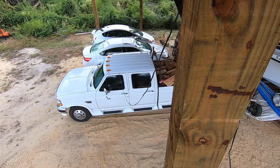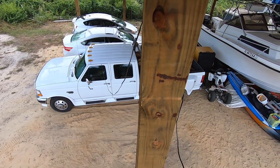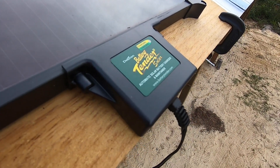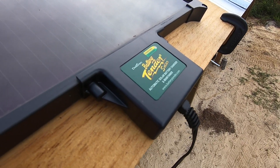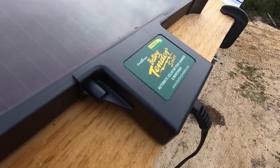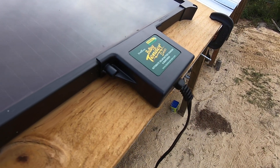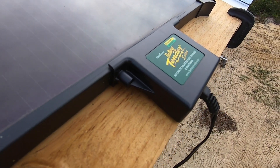The two batteries on the F350 have been charged up nicely and maintained. This particular model has the battery conditioner maintainer — once it hits peak voltage it keeps the battery properly maintained. I'm a true believer in that technology. I've had batteries last for years when I've used a charger with a conditioner maintainer. It will increase their life — I'm a firm believer in that. That's a real nice plus that comes with the 15 watt Battery Tender solar charger.